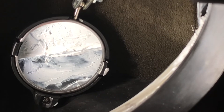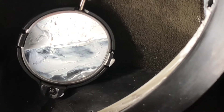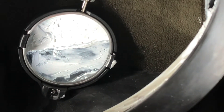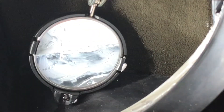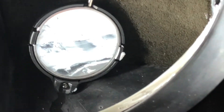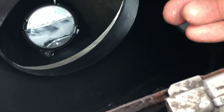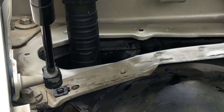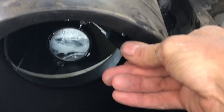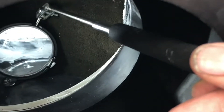I've got the camera inside the little compartment here and I'm just going to try to put caulking in there - you can't really see where I am but I can feel it. So I'm trying to seal that off with caulking all the way across here so that anything that hits that firewall and runs down will then hit the caulking before it hits the foam, and it won't rely on that foam to seal the water out. Looking through my mirror back at the firewall you can see I brought a bunch of caulking down in there to cover the foam. You pretty much have to do that without being able to see anything, so you're kind of going by feel, but then you can kind of stick a mirror in there and see if you're doing okay.